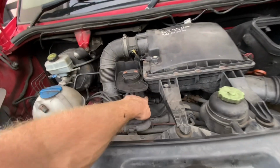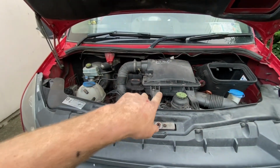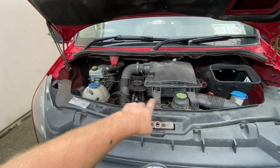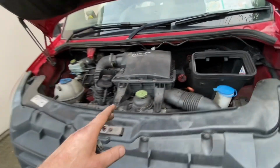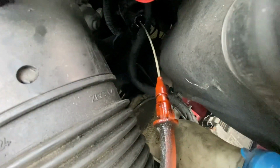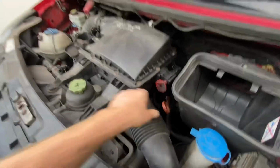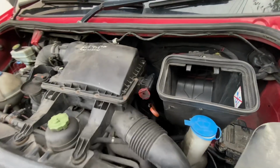I was thinking that that little vacuum pipe going onto the rocker cover might be something wrong in there, a PCV valve or whatever it's doing. Some of you might point it out. I don't know why they put a vacuum pipe onto the crankcase. Is it for a PCV valve, a crankcase ventilation solenoid, or what? I was also seeing that the dipstick sitting here had no seal on the end of it, and I was wondering, maybe a little bit wet and damp around there. I was seeing a little bit of smoke dissipating up the way. I was wondering, was it drawing air in through the crankcase intermittently, and was that causing my problem?